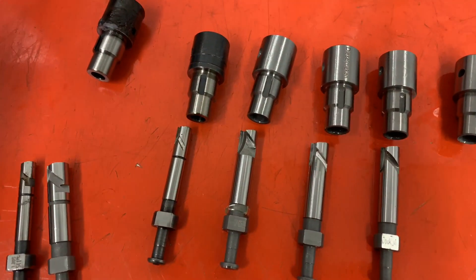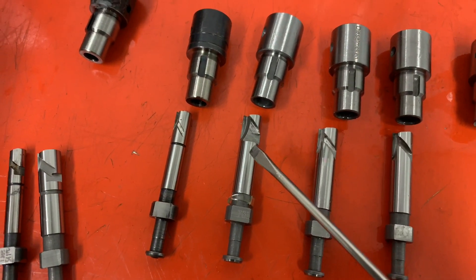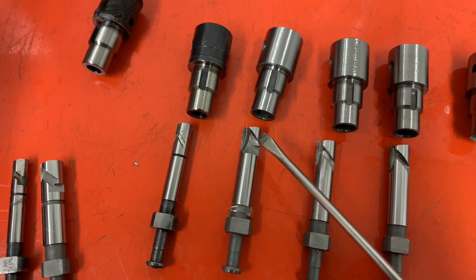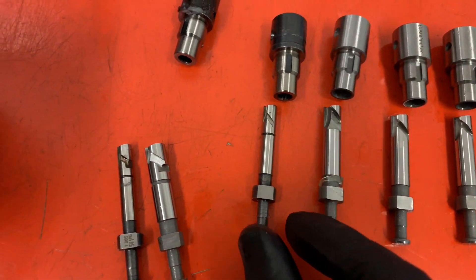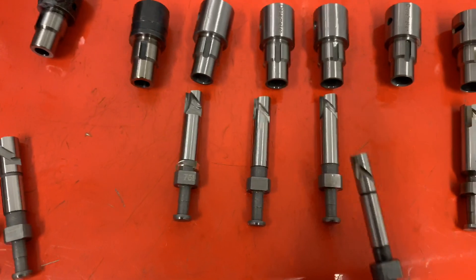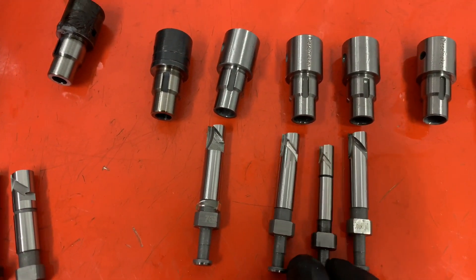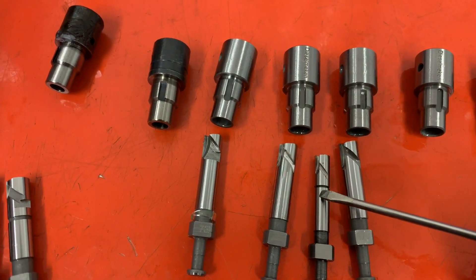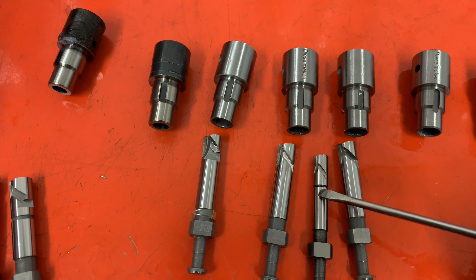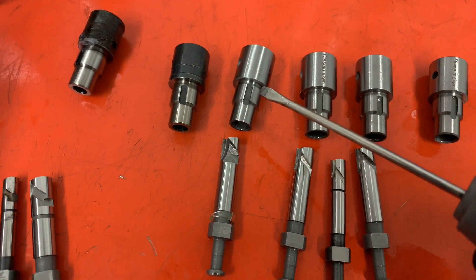This is quite an unusual element — you can see it's undergone quite a lot of changes. But then we can branch these three: the Bosch 6mm, the 7.5 and my 7.7 — all quite a similar design. You can see the Bosch has the lubrication groove in the actual element, whereas these two have got the lubrication grooves in the barrel instead.